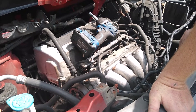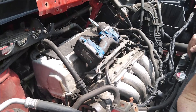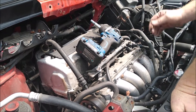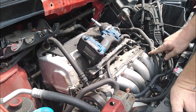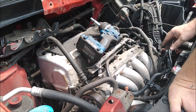I did this — I changed the knock sensor on this car about six months ago and had to remove this intake manifold. It's not too hard. All the bolts are right here. I know Scotty Kilmer made a video about this and kind of cried about it, but it's really not that bad. These are all 10mm.